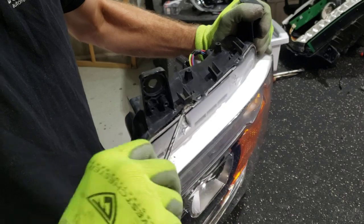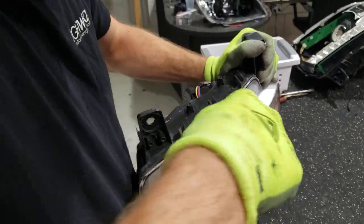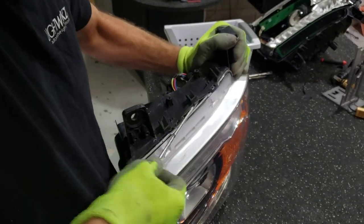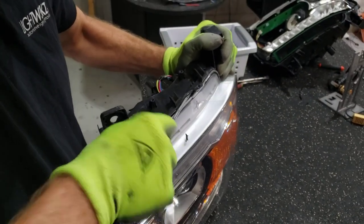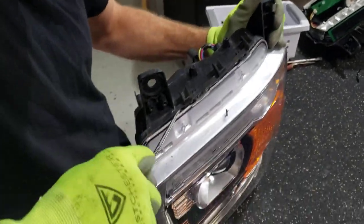The light's been in the oven for about 20 to 25 minutes, maybe a touch more, at about 240 degrees. And this GM Permaseal really isn't too bad. The Permaseal sticks inside of the channel, which is definitely preferable.